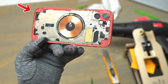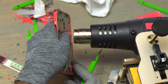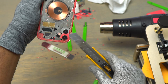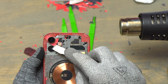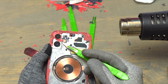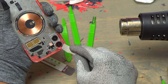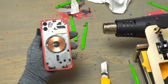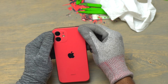While removing the glass at the bottom of the device, I used the big blade again with a lot of force, and I think something got damaged in that area. I still have some glass on the camera and at the edge of the device — those are the only remaining areas. I think the best combination for this glass replacement is to use a sharp flexible blade like the green scalpel together with a flat metal tool. Later, I will show you all the areas where there is no metal covering the components — those are areas where you need to be more careful, because going too deep will damage a component.